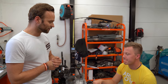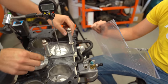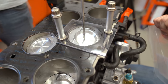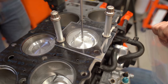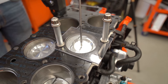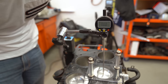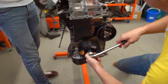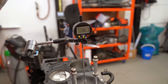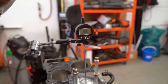That's why I sent Marius to the hardware store. He quickly bought a plexiglass plate. From that we built this highly precise, technical, great setup. Now we need to do the following things. First of all, we need to determine the combustion chamber volume at TDC. With this dial gauge we've just turned the engine to TDC. You can turn it through again, Marius, so that you can see at the end that it's at TDC.